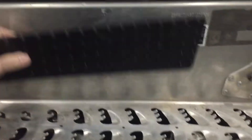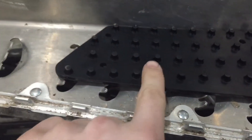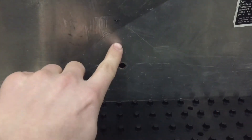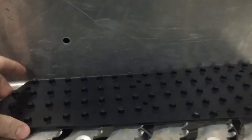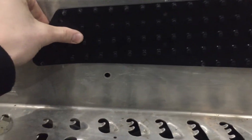There are one, two, three, four, five holes, and the fifth one goes pretty much just above this hole right here. All the sleds have it — I don't even know why they have the hole, but it's just a random hole. Line the fifth one up just above it, one inch down, and you'll end up riveting on there.